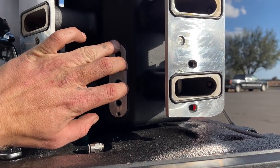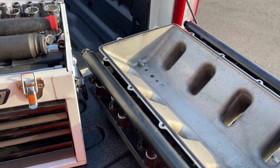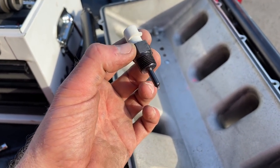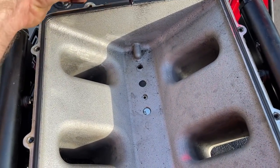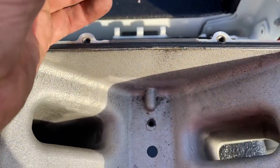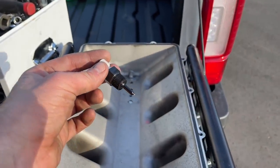I'll have my MAP sensor done directly to the intake to give us the most accuracy possible. What we're going to do is put this Riffe from Motion Raceworks manifold air temperature sensor in — I'm going to drill and tap the back of the housing right there, because I got plenty of clearance in the back but I don't have much clearance underneath the intake to put a 90-degree fitting for this sensor.